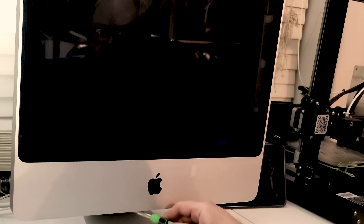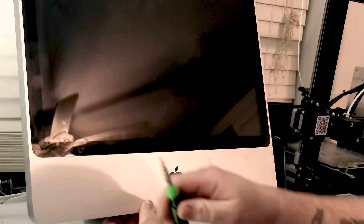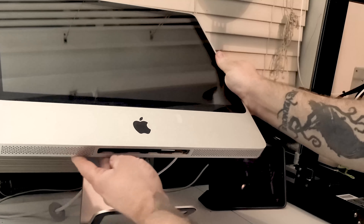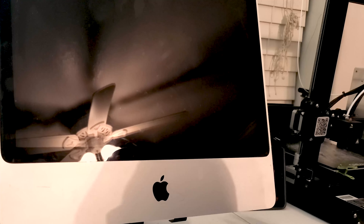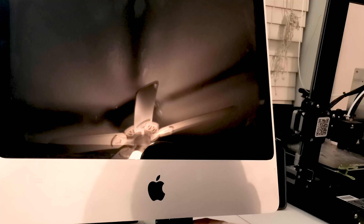The first thing we need to do is get under here and switch out the RAM — it's not very difficult. You just have to get under there with the right screwdriver bit. You've got two RAM slots down here. You pull on the tab and your RAM comes up. There's our one gigabyte chip, and we're going to put eight gigs into this computer. It officially only supports four, but with two four-gigabyte chips, if it likes the RAM it'll recognize eight. This by itself will give you so much more speed.